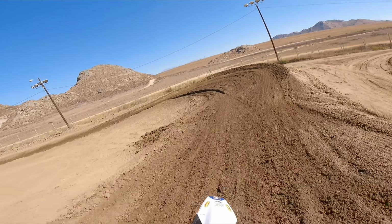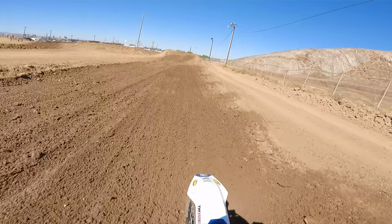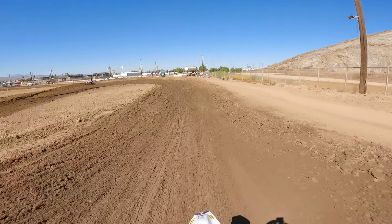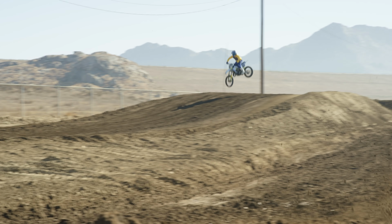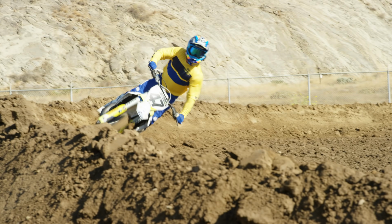That's an interesting concept, because in a four-stroke, that engine brake kind of throws the weight forward when you let off the gas, and that is your weight transfer, right? But in these, you don't have that. No. So if you don't allow that initial part of the stroke to dive in the fork, you don't get any bite with the front.